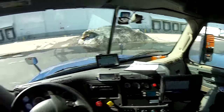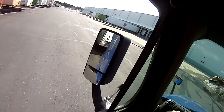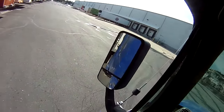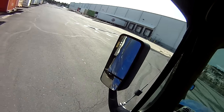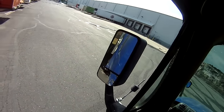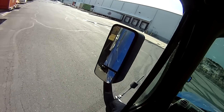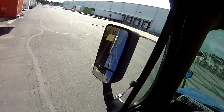I'll show you how to hook up to a trailer — we're picking one up. You want to put that drive tire right on that edge, see where that chrome strip comes down to the white. Back up nice and slowly. See how the truck dipped down? That means the landing gear wasn't dropped too high. So nice and easy, and back in.